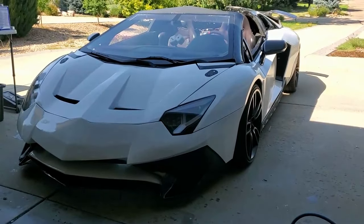So still a lot of work to do. Well, I hope you guys enjoyed episode 100. Nothing catastrophic or too interesting going on, other than the fact that I'm really chuffed about getting the power steering working. I was worried about that. It's such a Frankenstein, and there's also some compatibility issues between LS1 pumps and some of the Mustang 2 racks, and so I got that all straightened out, got all the proper fittings, and it seems to be working just fine. So pretty happy with it.